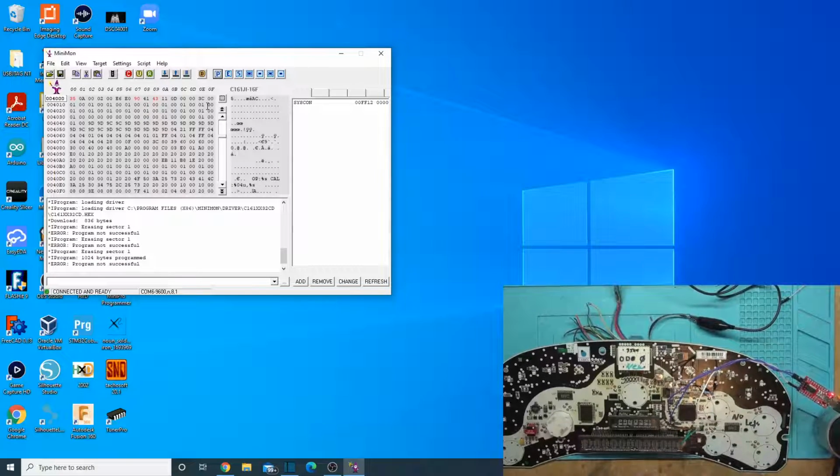My first assumption when I started seeing this was, oh god, I damaged the microcontroller, because this was the first one I put a new microcontroller on, and I'd been running that wrong driver on it over and over again. Sorry, before I even ran into this, I programmed one board. It was just a random one out of the pile, and I had no issues. It just programmed right away. So I was like, cool, problem solved. This was the second one I tried, which I put a new microcontroller on. But it was one that I had already tried to use the wrong driver on. I'd used the JI driver on it and tried to program it. It didn't work, so I thought I damaged it with the wrong driver, because I tried a bunch of times with the wrong driver.